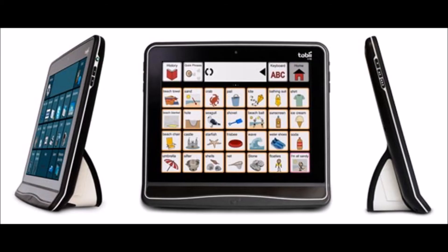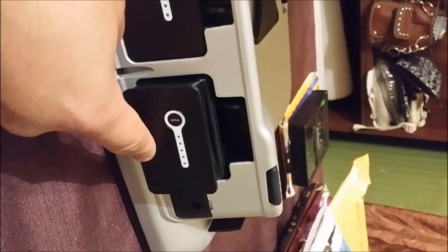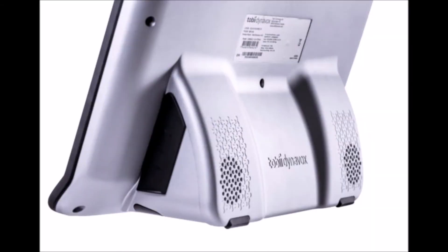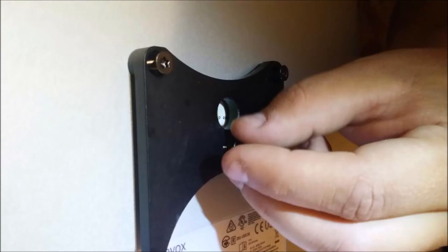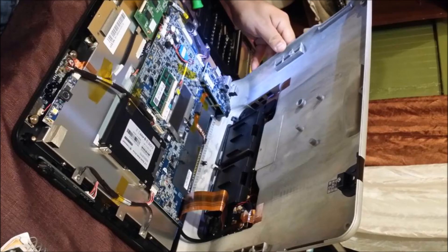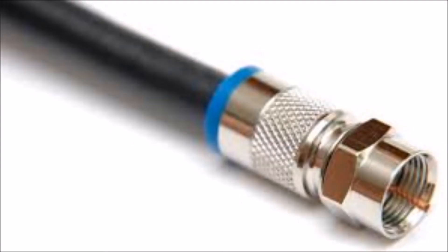Now place the Tobii face down on a smooth surface. Remove both batteries from the bottom, then remove the T9 Torx screws from the back of the device. You do not have to remove the rear mounting bracket. After all the screws are removed, slowly lift the top back of the device to hinge the cover. Do not pull the ribbon cable — leave the ribbon cable in place.